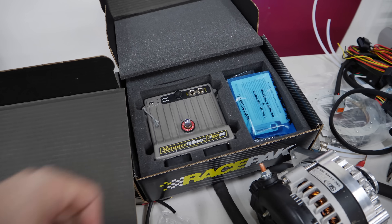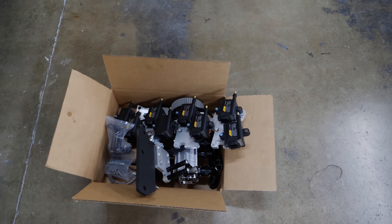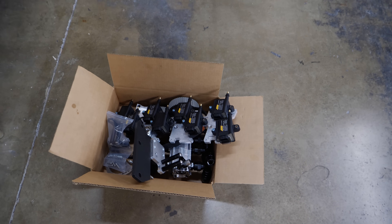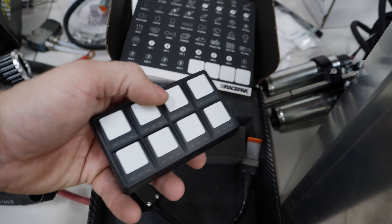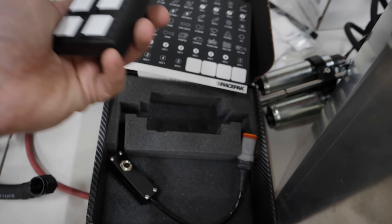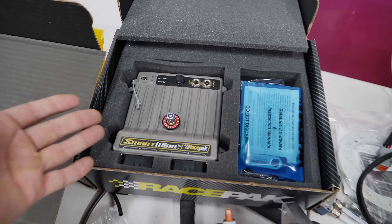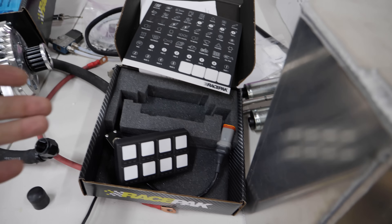The only thing you do not wire into this is ignition. The actual spark plug coils don't go through that unit — I thought they would, but that's one thing that draws a very freakish amount of current up and down. If I wanted to, I could start the car like you see with race car guys — pressing and holding one of these buttons, setting this button up, turn the starter for say three to five seconds — but I want this car to be as RX-7-like as possible.